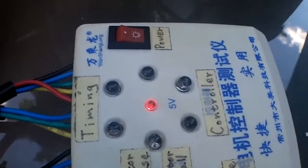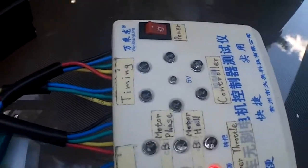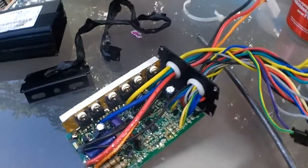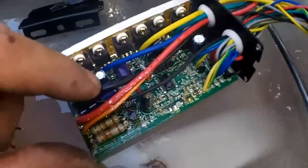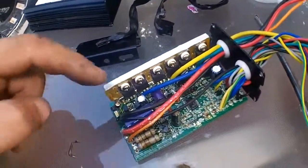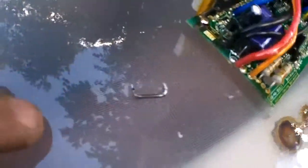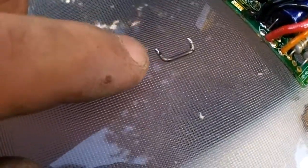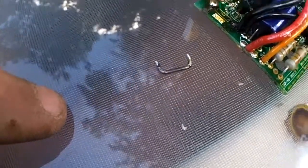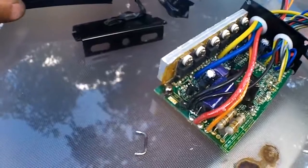So we're going to have to go through the wiring on the bike — it's been spliced and diced about a zillion times. As you can see, the controller has sustained some damage. The cap is blown, the chip still works, but the FETs are blown. And as you can see, it used the shunt as a fuse, which they do on these cheaper bikes. I'm going to try and wire up another model and see if that'll work, but this controller is toast.